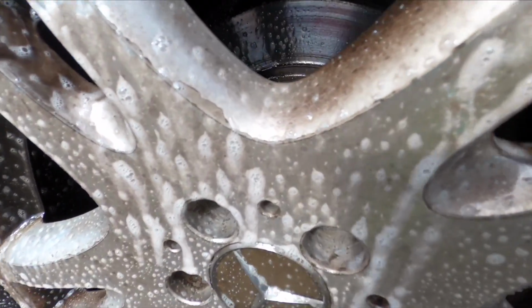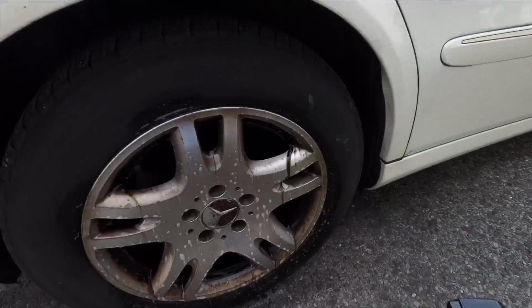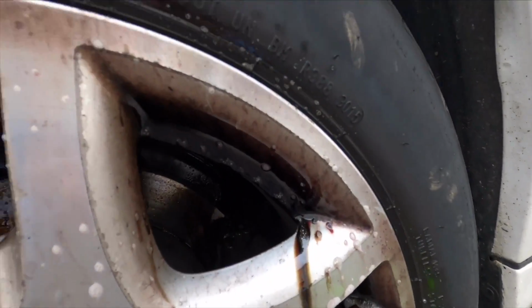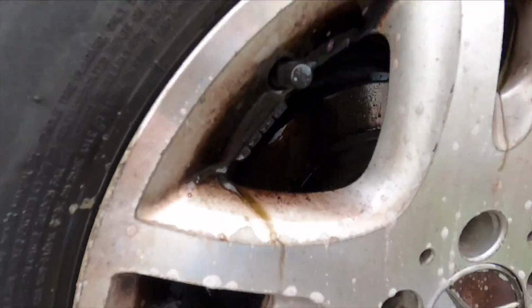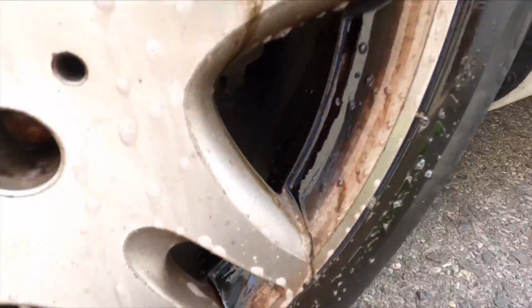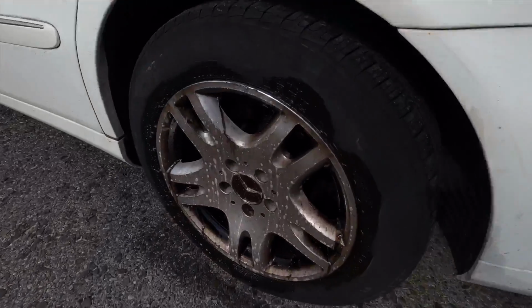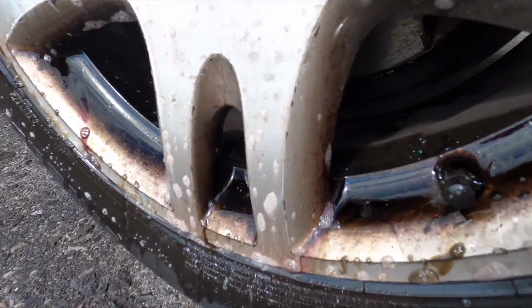So I sprayed it on the wheel here first. The wheel wasn't cleaned, and this is where the source of your ferrous metals come from, braking systems or rail lines and heavy trucks when it's on the back of trucks during transport. And as you can see, it's starting to break this down right away. And if you let it sit the 3, 4, 5 minutes that's necessary to work on removing those ferrous metals, it's effective. And you'll see it turn purple.